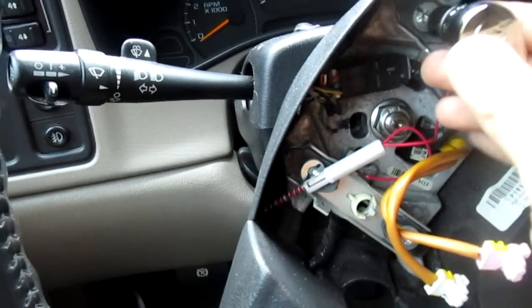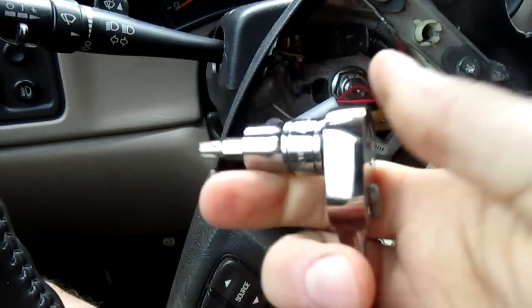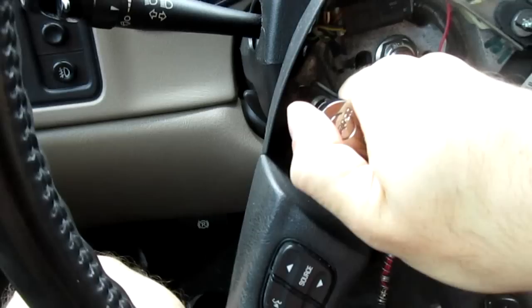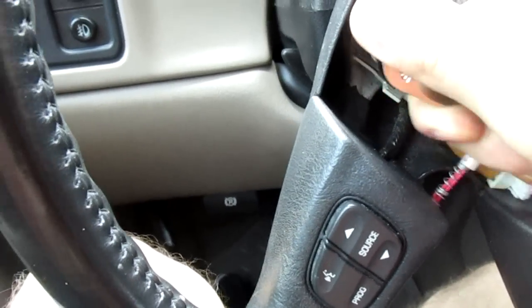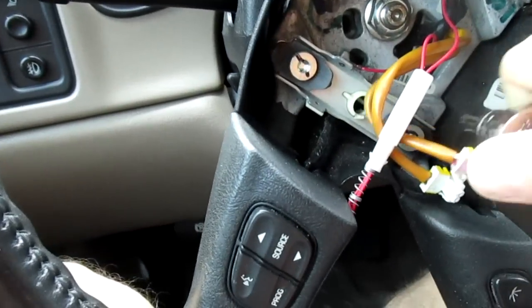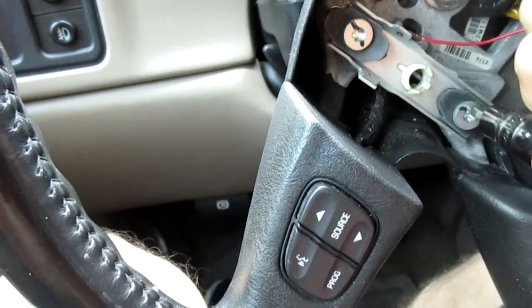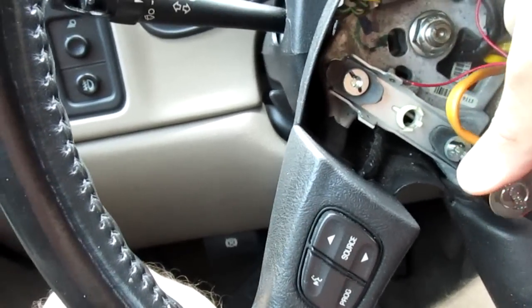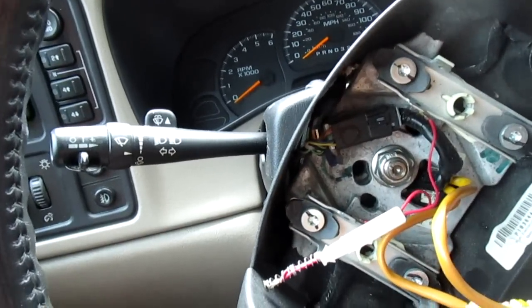This is a T27 — I thought it was a T30. Look, I got this Snap-on tool. It's a 3/8th drive mini, and it works very good for little Torx things. This actually might be a Torx Plus fastener — they use that on a lot of new cars. I need to get a set of Torx Plus. Get these four things off, then you can get these contacts off.